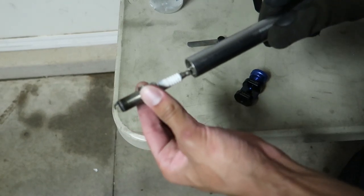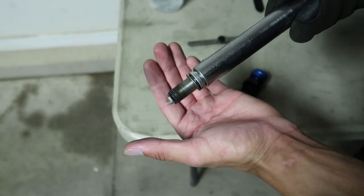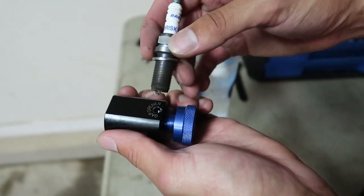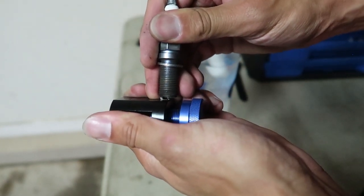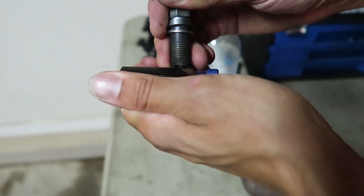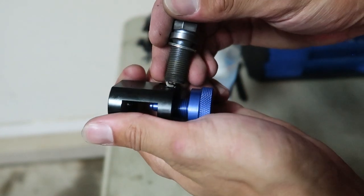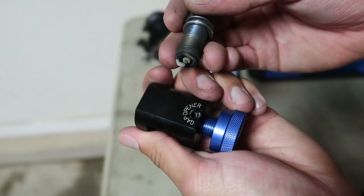Then you got your magnetic tool so your spark plug doesn't fall out when it goes in. Super convenient. And just to show you guys how this gap opener works — this is an older Brisk plug — basically just go in there, give it a little bit of pressure. You're going to have to hold and push the spark plug down as you go back, but you just do this and it'll open that baby right up. It's a pretty simple little gadget they added on the back there. It's nice. I dig it.